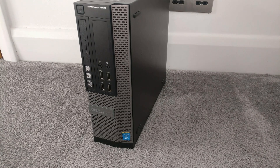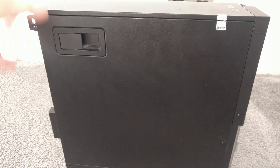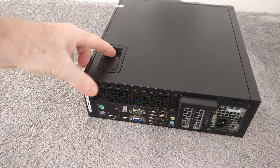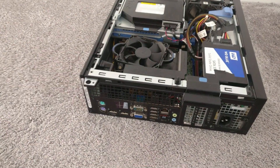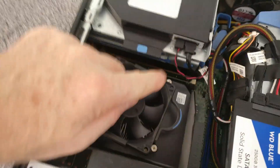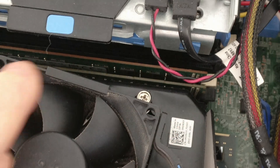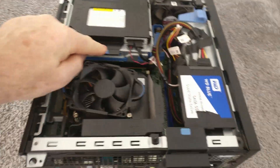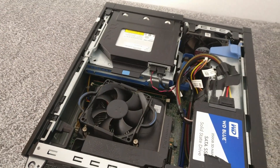The next thing you want to do is open up the PC so that we can get access to the memory chips. Have a little look around and see where your removable panel is. You can see here I've got a little catch on mine. Pull the clip and remove the panel. Taking a quick look inside, you can see there are my RAM chips in there. Your PC may be different, but these are easily click-and-remove with these little blue adapters, so I'll just take these off and then we can look at the RAM slots.